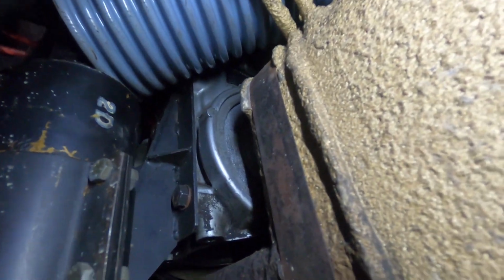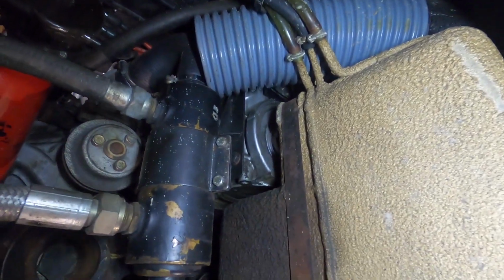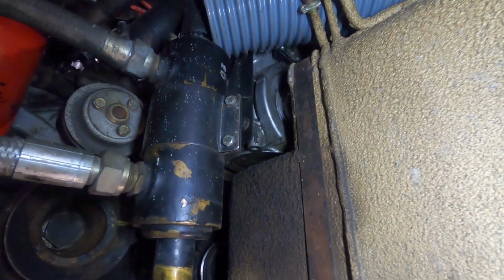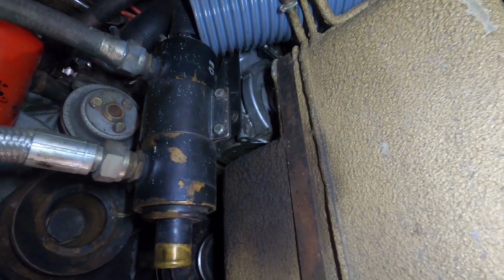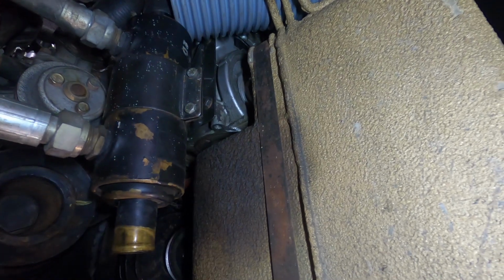Another thing on our project that we want to take care of is the AC compressor, which is another bowl full of crazy that's tucked inside this notch of the fuel tank. So I want to change some of the lines, because again, same thing. I could go ahead and try to charge the air conditioning system, because the customer is like, I'd really like to get the air conditioning going. My feeling is, okay, but the lines running from the front to the back of the car are 50 years old. So it's time to change these hoses, because I could charge it. It may hold pressure for a little bit, but within a year, it'll run out of refrigerant again.